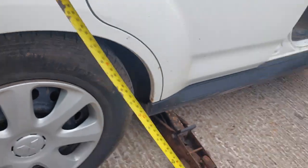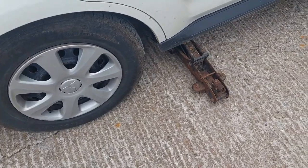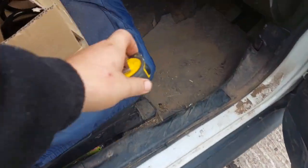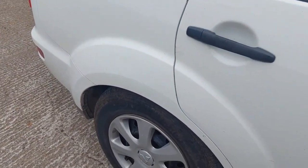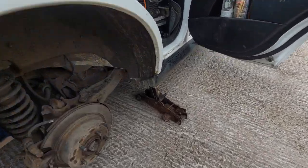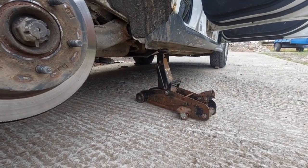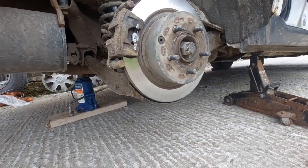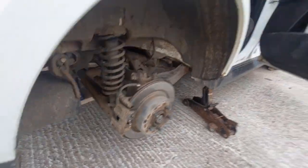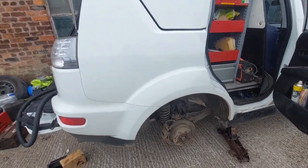We are 70 centimetres. So let's get this jacked up, get it all safe, then we'll take the wheels off. We've got it jacked up — I've got it safer than it initially looked. I've got a big jack under the rear cross member, a trolley jack on this side, and another jack on the other side. Three point contacts, so theoretically it should be pretty safe and solid.